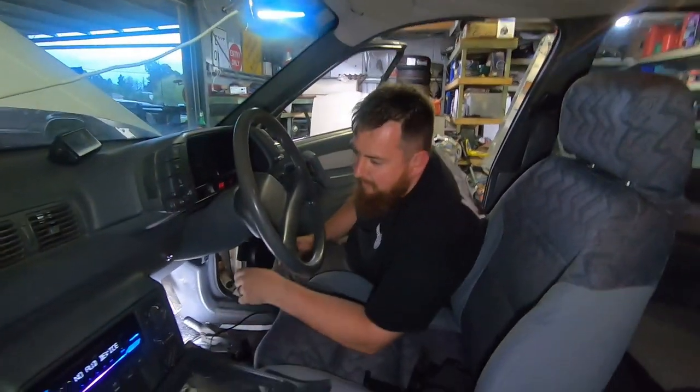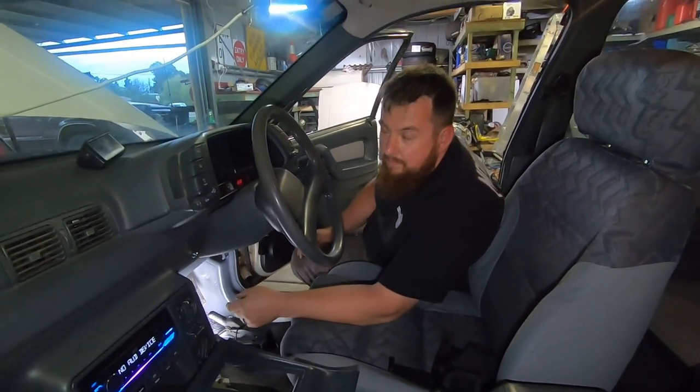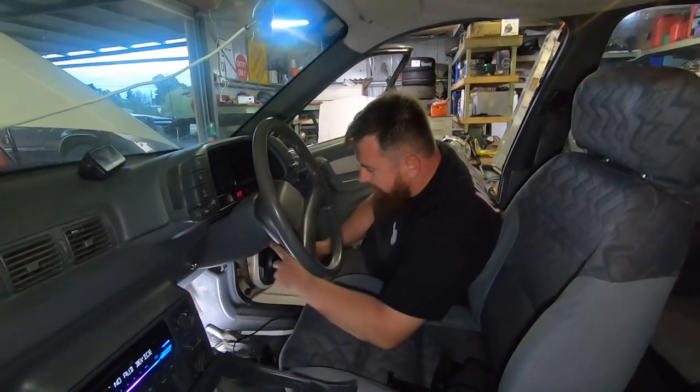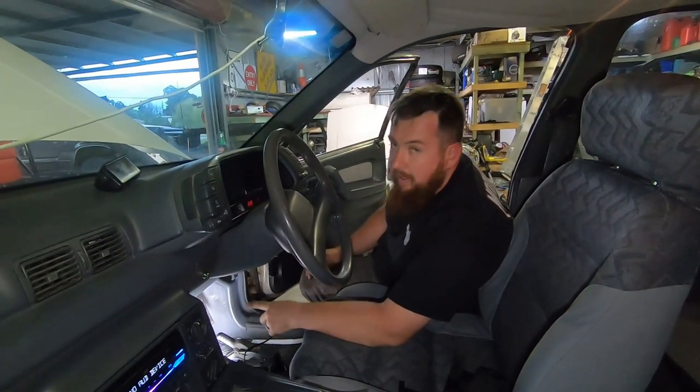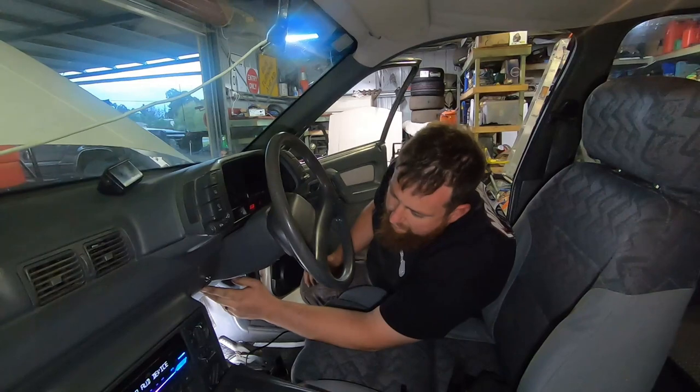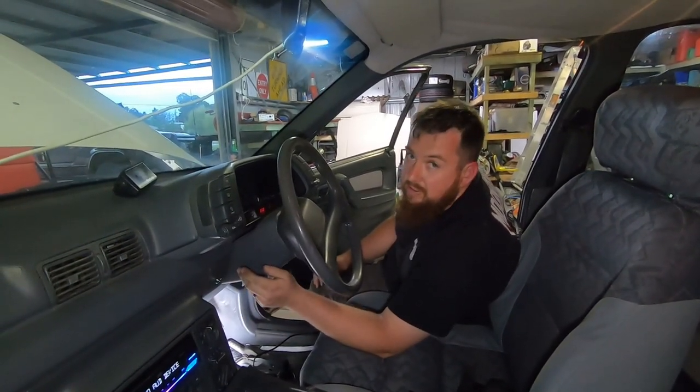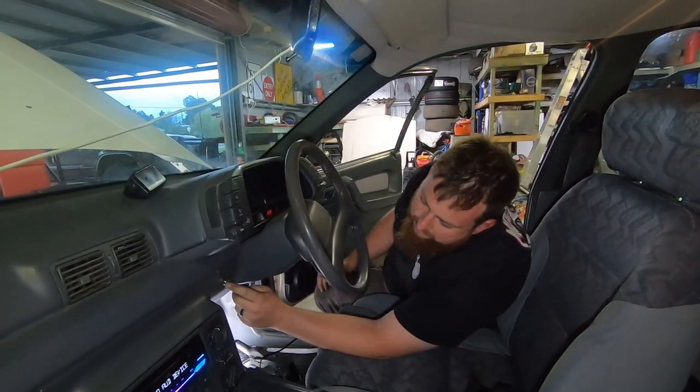How are we going in here? So I've got the wiring done. Comes with an inline fuse, a little 4-amp fella. So I've just tapped into a switch power in the fuse box, taking it down here to a switch, which was already in there for a set of driving lights it had. And we've added this little green light.